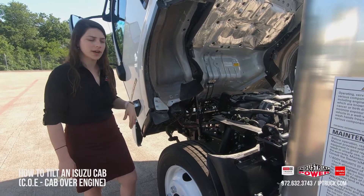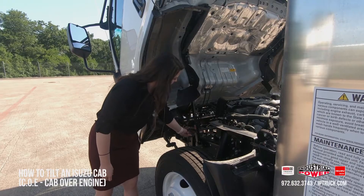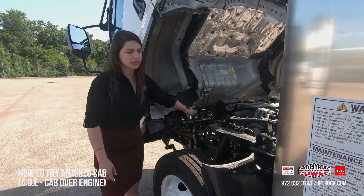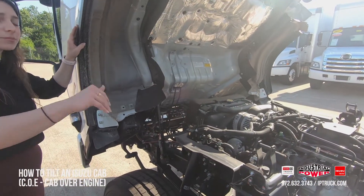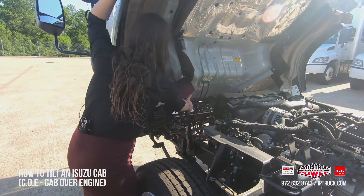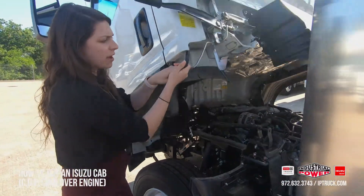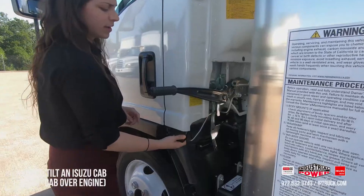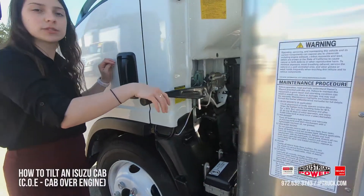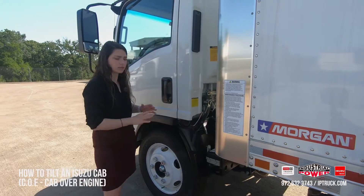Now we're going to undo it and bring the cab back down. We'll pull this little key piece back out and stick it back inside of its little house. Then we're going to go ahead and pull this down — this one takes a little bit more muscle, and on the Hinos it kind of comes down on itself, so you just want to make sure you're holding onto these pieces up top. We're going to squeeze this and pull it in. Once it starts to bend, we're going to start pulling down on the other one. Pull it all the way down — it comes down nice and easy and you can hear it latch. This piece has already latched itself, these have already latched. Now you just have to push this big one down. This one takes a little bit of muscle and you hear it latch — super easy.